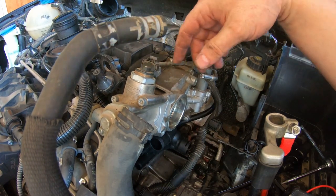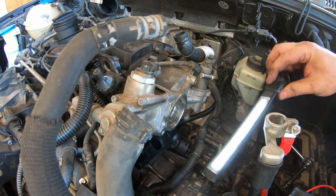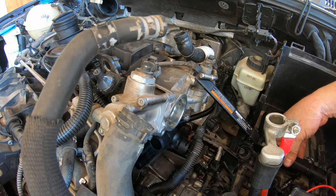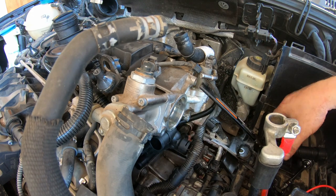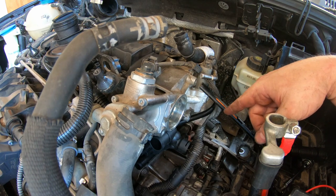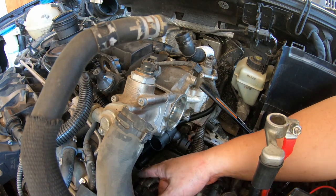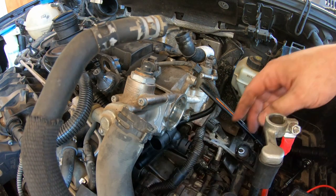So now I got that bottom hose. Hopefully you guys can see this stuff. My light's getting dull. Let me see if it's... Yes, it needs to be charged. I left it on. I got that bottom hose on. I used a screw worm clamp. I was tired of messing around with that spring clamp, especially because I didn't have the right kind of pliers to put it on. So I got to put this hose down there, this hose here, and then I've got some vacuum line coming to fix this little mess going on there.